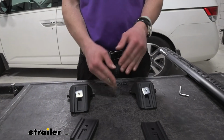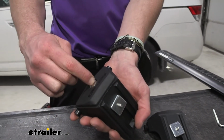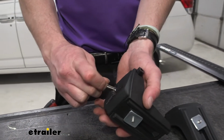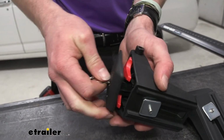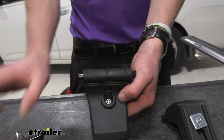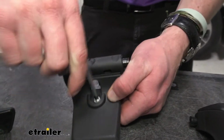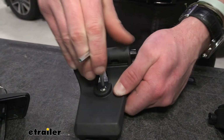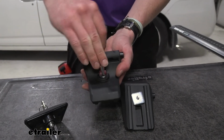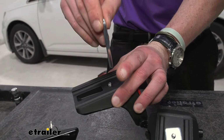We're going to have one extra step when we're putting the spacers on. First, we want to take this cap off because it's blocking what we need to get to. Take your key, unlock that, and that's what we were seeing underneath. And now we have a little bolt. So we can take that same exact tool we just used. We're actually going to completely remove this little top section, and also the bolt.